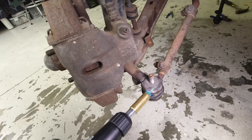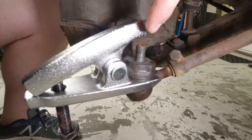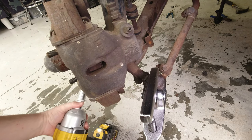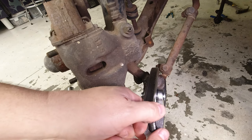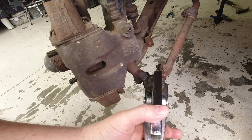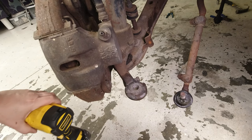The other thing that can help with tie rod end removal is the application of heat. So this time we use the right tools — and do wear eye protection, because there's going to be a significant amount of kinetic energy stored in this stuff. That actually came out really easy. I'd just done the other side and it basically exploded out, but it came out a lot better than I was hoping. We're loose and good.